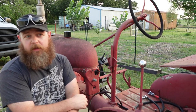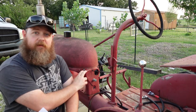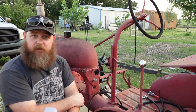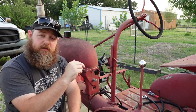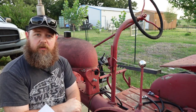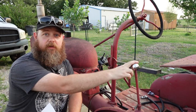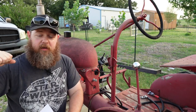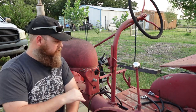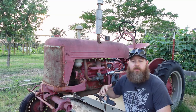This one does not run — I am working on getting it to run — but I do know the process. Understanding how it starts made things a lot simpler. The first thing is you have this lever and you pull it back to pull the choke. Next, you pull this out to tell the electrical system you want to start, and then you pull this lever to actually hit the starter connected to the motor. Once it starts up you push this lever back in to let off the choke and you're ready to go. One important thing to note: you shouldn't have it in gear when you start it, especially because this thing has a crank start — if it's in gear and you crank-start it, it's going to jump forward and run you over. So starting is fairly simple: pull the choke, pull to start, let off the choke, and you're ready to go.